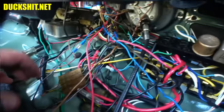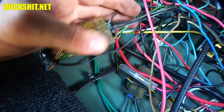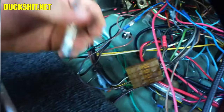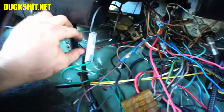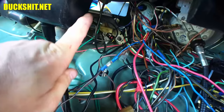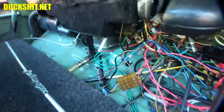I wonder what's going on with the wipers. I guess we'll have to chase the wire on that — it could be down here. I think it's a green and a black wire that goes up to the wiper, so we'll have a look under the hood and see if we can get that sorted out. Wipers typically have their own harness. Is this it? Yeah, there it is — black and green wires. And those are the ones right there. There's already been a splice put in there. I'll have to check all these connections. Here's our ground. These are not factory wires — these green wires, you can see. Those go into the start wire — yeah, start button, that's exactly where they go to. Anyway, that's our wiper harness. We've got to figure out why this doesn't want to work right. I'm going to do some voltage checking under there.